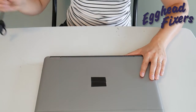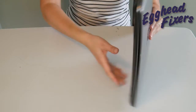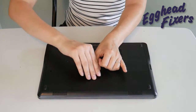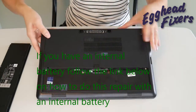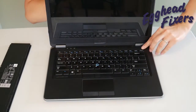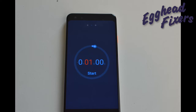First of all, we're going to have you unplug your power cord and take out your battery. This is the procedure that oftentimes when you call into warranty repair from your manufacturer or an IT support line, they'll have you do, because it's just that effective. Once the battery is out and the power cord is unplugged, you're going to hold down your power button, just like so, and you're going to hold it down for one whole minute.